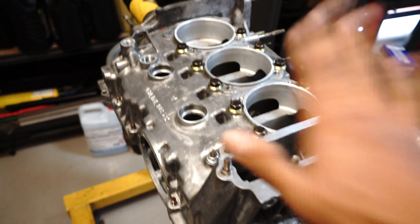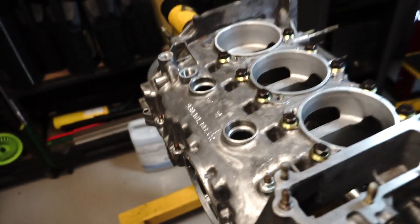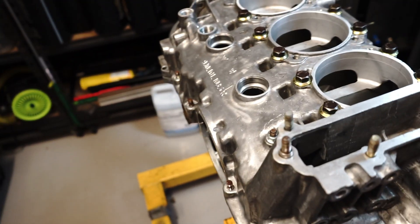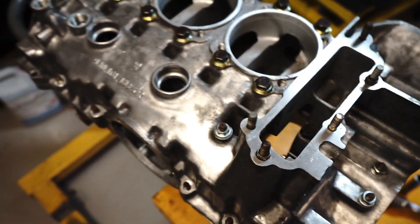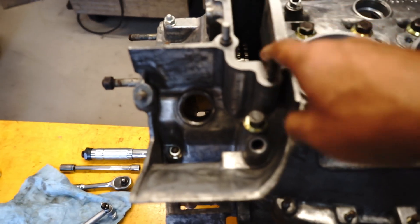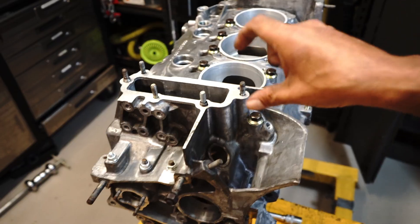So I've put the case together dry — no sealant between the main journals. I also took the opportunity to install my intermediate shaft, because I wanted to make sure I had a nice freely turning intermediate shaft. If I put my hand in through the bottom and grab the end of it, you can see it turns nice and freely, and yes, I do have all the nuts installed. I've torqued the entire case now. I'm going to pick one journal — it's going to be my number seven journal.